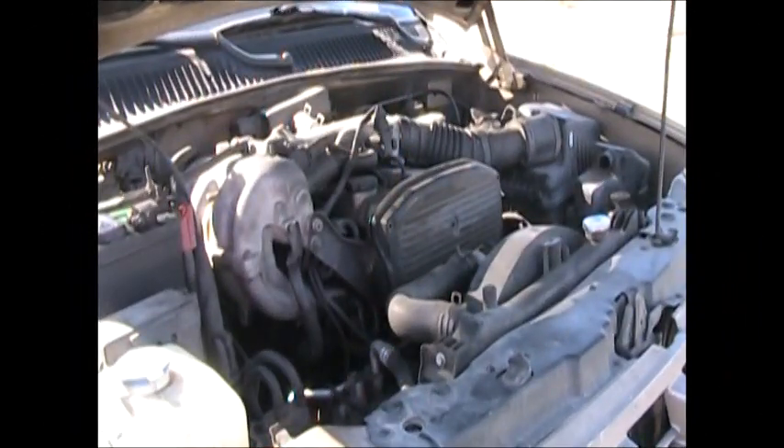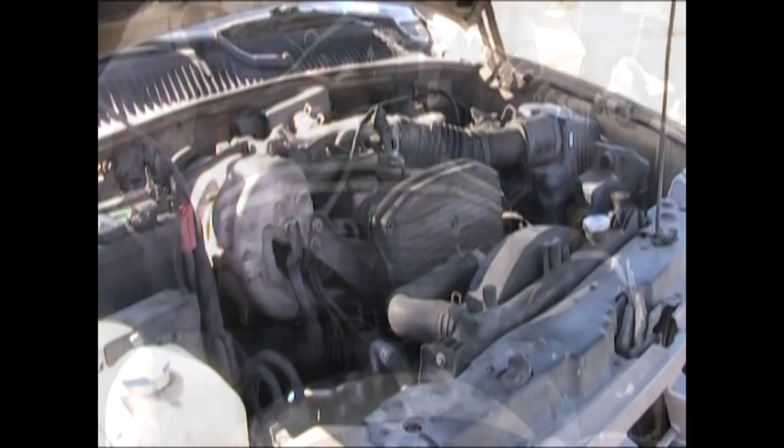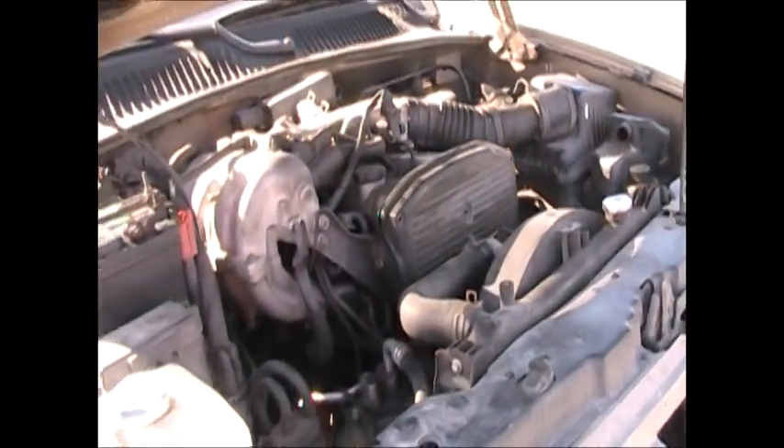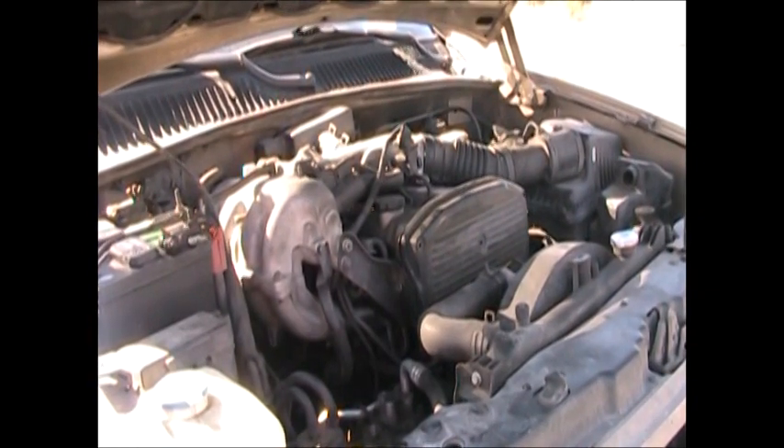A 2001 Sportage has a Mazda FE3 motor which is 2 liters and has a double overhead cam. This particular FE3 motor has broken its timing belt. I've attempted to figure out if this is an interference motor or not, but I'm getting conflicting information on that. The arguments for it being a non-interference motor sound a little more solid than the ones that argue otherwise, but really we're going to have to just test it out and see.